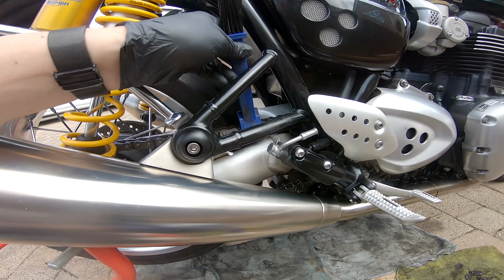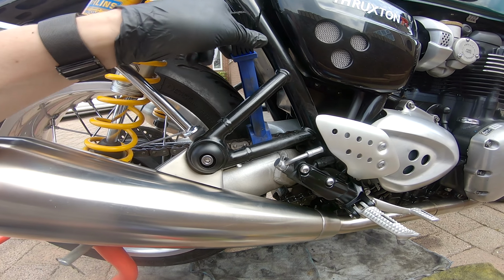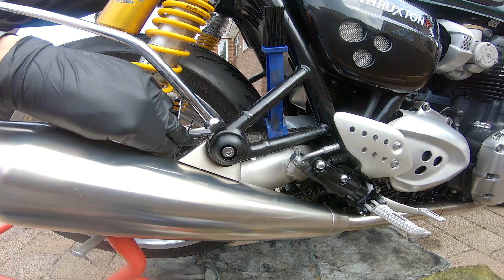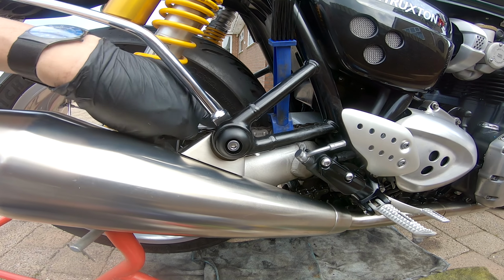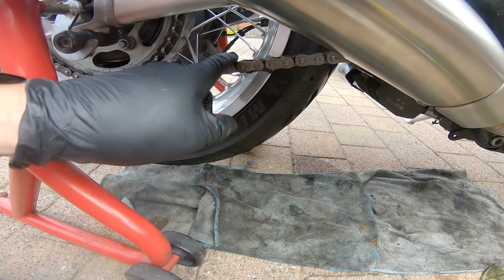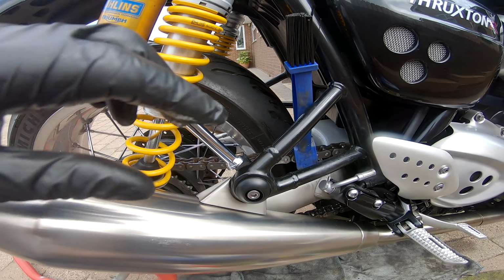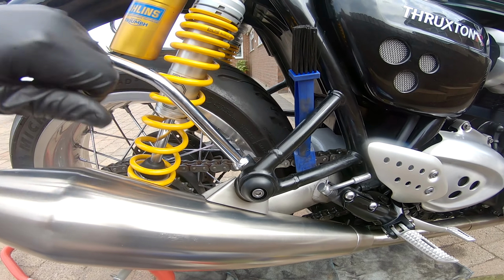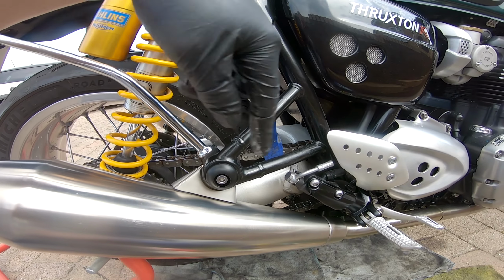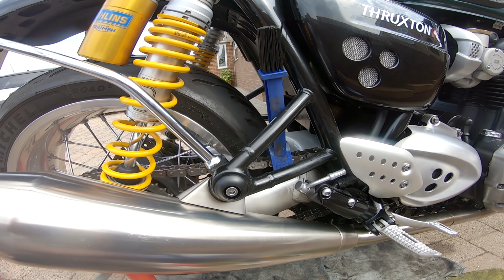Chain brushes come in different sizes and there should be a good fit. You can see there, that's a tight fit. So I'm putting it on this way first, and because of the 3 sides of the brush, it's cleaning both sides of the chain and the top, probably sideways down here. Put the thing sideways so it's cleaning the bottom. Now there's 2 ways you can do this. You can either just hold that in place and spin the wheel round, which is good, but I like to move the brush backwards and forwards as well, because then it's really attacking it from every direction.